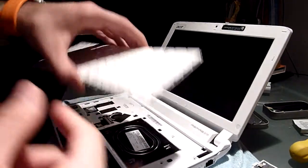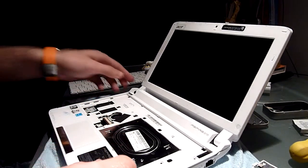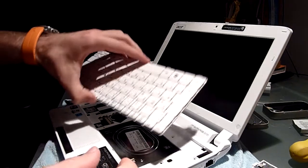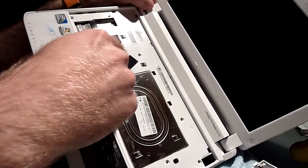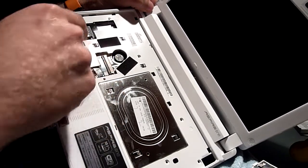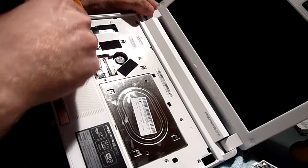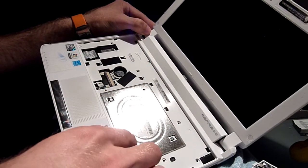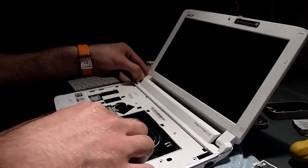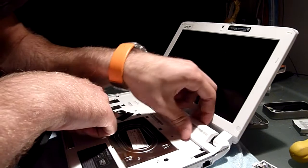You can actually change the keyboard — change your layout from German to English or from English to German with the same method, if you buy a keyboard by itself anywhere else. And you will see here the innards. We have the fan right here and two more plugs. You have to unplug those for the main board and unscrew another seven screws in here — so it's 22 screws total to get rid of.